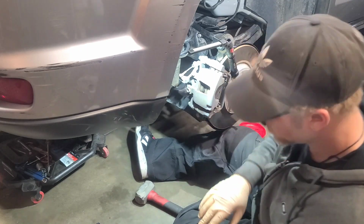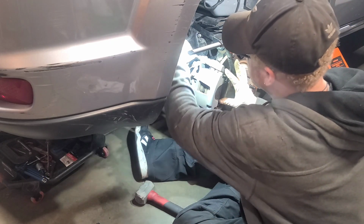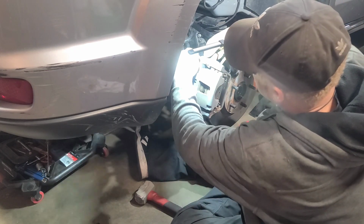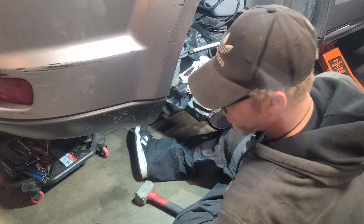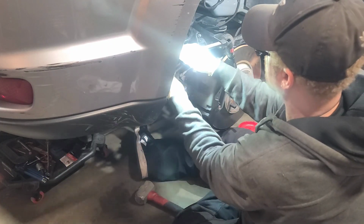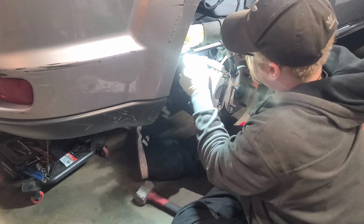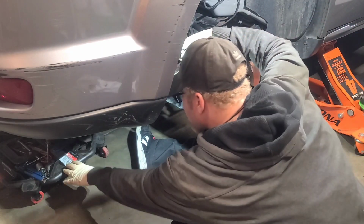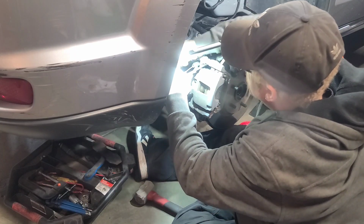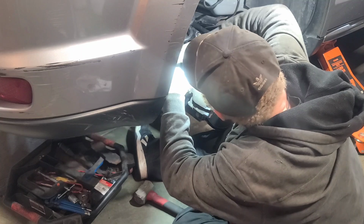All right, let's go ahead and tighten everything down. Grab our miniature ratchet. And if you feel it binding, back up because you're cross threaded. So like this is spinning here. I'm gonna hold it. If you can't hold it with your finger, you slide a screwdriver or something in there to keep it from spinning. So it's starting to spin. Just slide this in here, see if I can hold it still. Yep, there we go. Well, let me do what I said and get the screwdriver. And I'm just getting it close before I do the bottom. It should be pretty close, about right there.